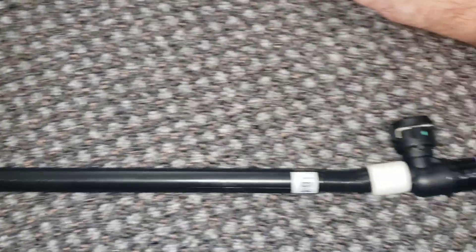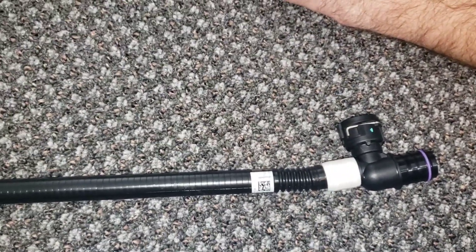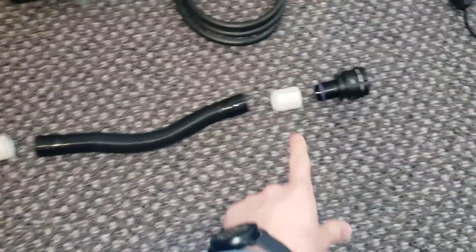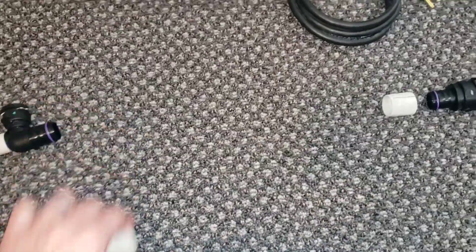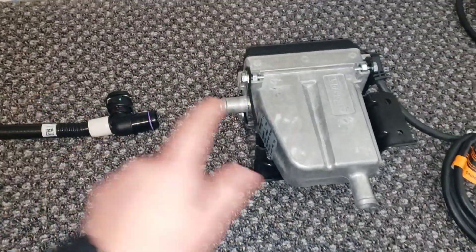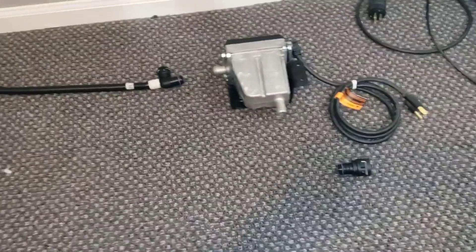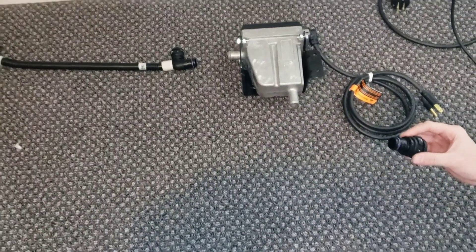Both parts were purchased from the service center. We've completed modifying the coolant hose — Jordan cut the sleeving on both sides. We're going to get rid of this hose and these sleevings, and move this connector to the side where the arrow is pointing for the coolant inlet, with the outlet coming out the other side.